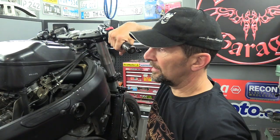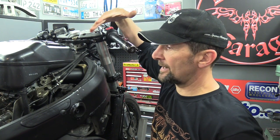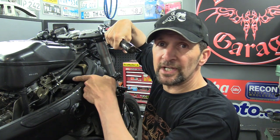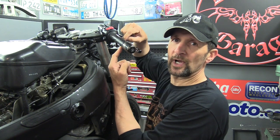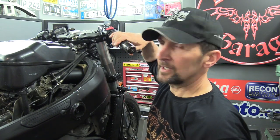The first thing is this. Throttle cables to replace. They're in a terrible state, just jamming up, not returning. It's not the spring here on the throttle bodies, it's just cables full of gunge and chew from 20 years, original factory ones, along with the tube here, because that's probably all gunged up and worn as well. It's rattling about, and some new grips. Next thing.